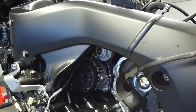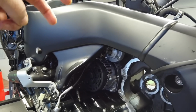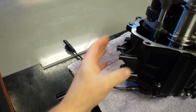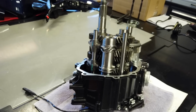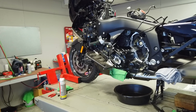I was able, using some special tools, to lift the whole intake manifold, get in there and loosen the screws to this bevel gear. It's got two that go in the top and then two that go in the side. The two on the side actually go into the starter motor, and the two on the top bolt right here on the transmission. Well, I thought maybe I could pull it away from the starter, but then the bevel gear would hit the frame. I thought I could get the transmission to come out loose enough that I could pull it out. Well, that didn't work yesterday, so anyway, I found another way. I got it out. That saved me a considerable amount of time. A little janky, but it's easy. It's easy to do. It's just that first time it was a little awkward.